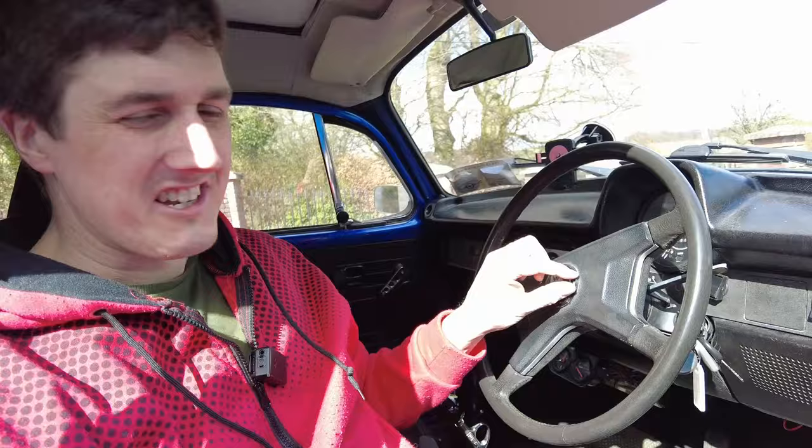This is one of those jobs I thought was going to be a straightforward affair and it has proven not to be. I took the steering wheel off, cleaned the horn ring and checked the connections on the button. I've taken the horn off, cleaned the connections and checked the connection point under the bonnet, but it's still not working properly. I even tried a different horn - same situation. It just buzzes rather than beeps.